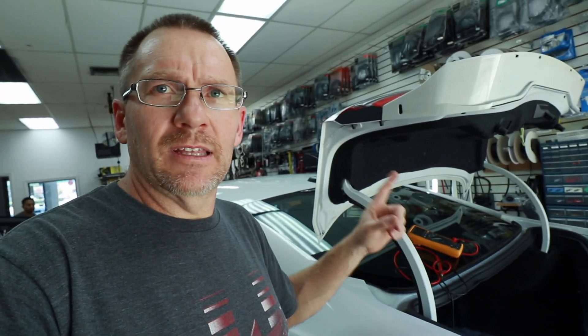We turn it on and take a listen, and the speakers in the doors only put out bass. Some manufacturers - Honda in the Pilot and the Ridgeline - have a sub amp built into the radio that powers the factory sub, but Ford has never done that. That leads me to believe that there's an amplifier somewhere in here powered just for the subwoofer, which they have done.